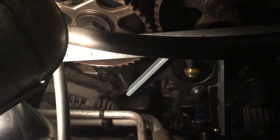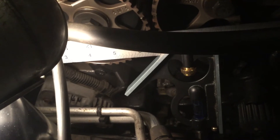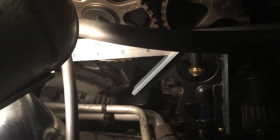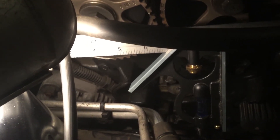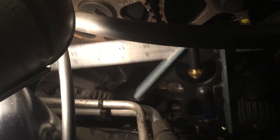As you can see right now it's not doing that. But once I get closer to installing everything, I will make sure that everything is just about there — so that the left mark on the exhaust sprocket, the right mark on the exhaust sprocket, the left mark on the intake sprocket, and the right mark on the intake sprocket, along with the two bolts, all pretty much run straight through the middle to be fully lined up. And that will be top dead center.